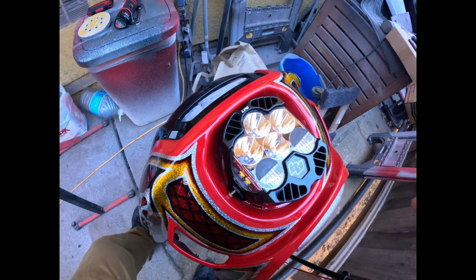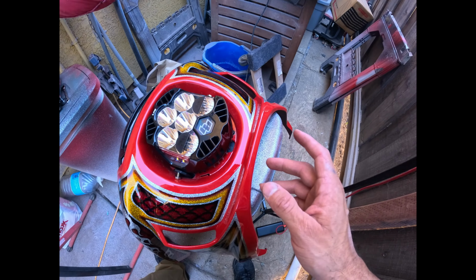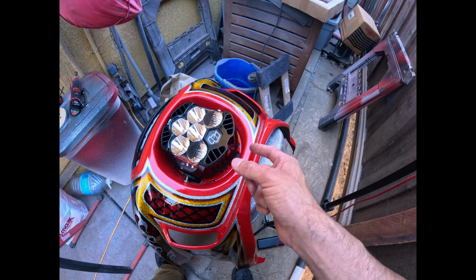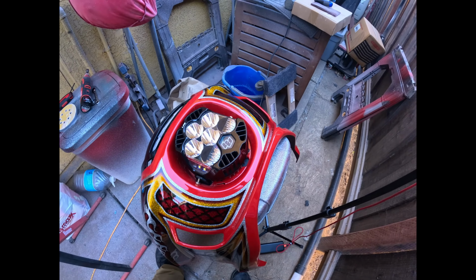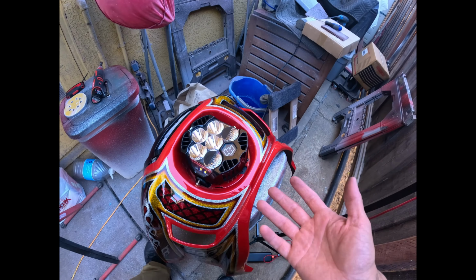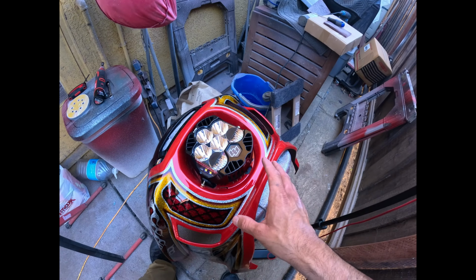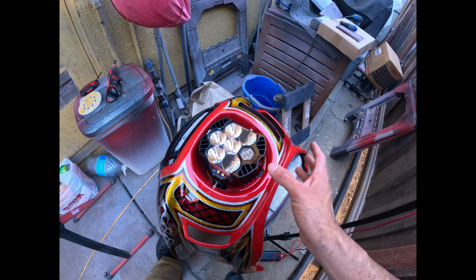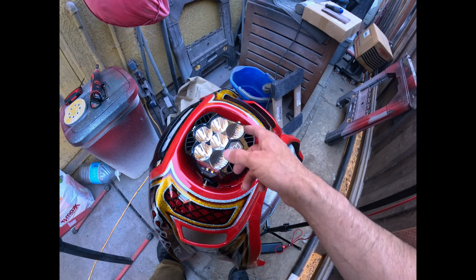And then of course you could already see how much better it looks now that it's recessed by, I'd say, almost half an inch, because you calculate the thickness of the bracket and then the thickness of the fairing, and combined that's about 3/8 to half an inch that's recessed in. So now you don't even have to buy the $120 option. You could just do this modified, and like I said, you can still use your OEM light, even if you decide to put it back on there. You're not compromising the fairing by trimming it out. You can still use it.